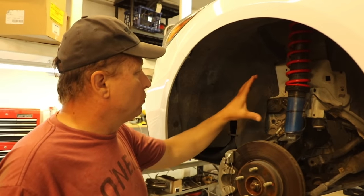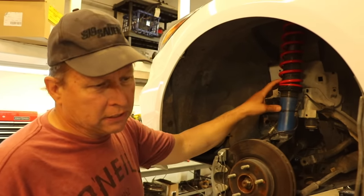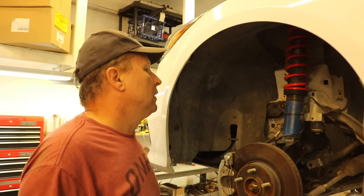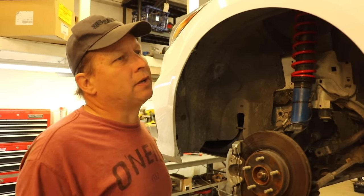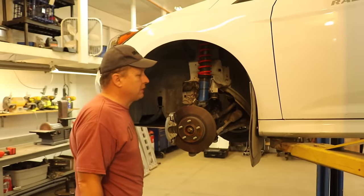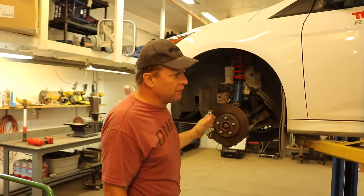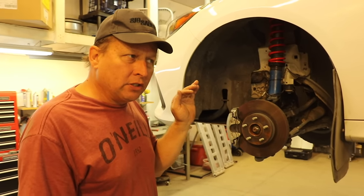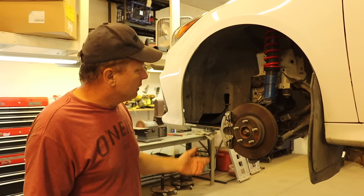We use a 250-pound, 12-inch-long spring, so we have 2 more inches of travel and it's much stiffer — about 30% stiffer than the original, which seems pretty close for gravel. We still need to work on the rear shocks; I need something a little stiffer there but I'm playing with that right now. We've had no problems with CV joints increasing the suspension travel — raising it 2 inches hasn't had any effect on the CV joints.